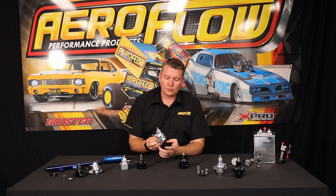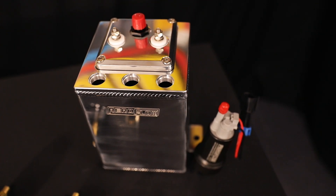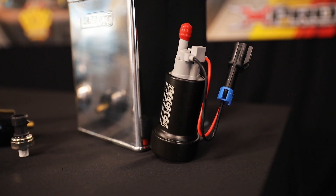In addition to the four ports on the side, there are also two auxiliary 1/8th NPT ports on this reg. That means you can run a gauge so you can see the pressure while tuning from the front of the engine, and also a sensor in the other side to feed the data to your ECU. So there are multiple options there — it's a great product.